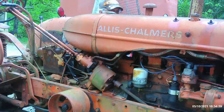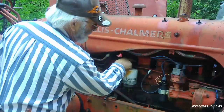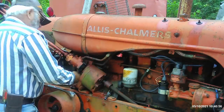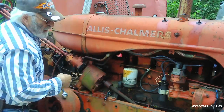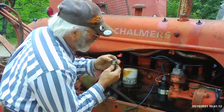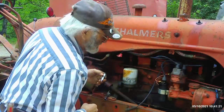It sounds good turning over anyway. Now that we've got those few revolutions on the motor, the float is actually sticking on the carburetor — kind of a good sign, kind of a bad sign. I pulled the number four spark plug, got it grounded right here against the block, turned the power on to check for spark on number four. No spark on number four. If there's no spark here, chances are there's no spark on the rest of them. There's also no fuel on the plug, just a little bit of carbon. So I'm going to pop off the distributor cap and see what's happening inside.